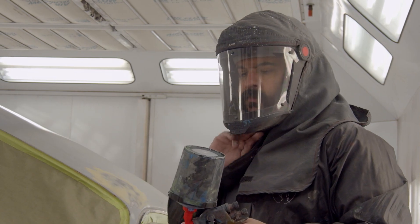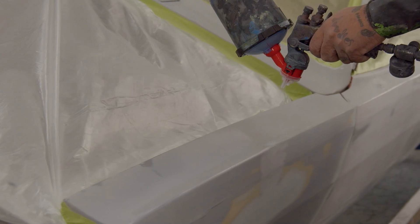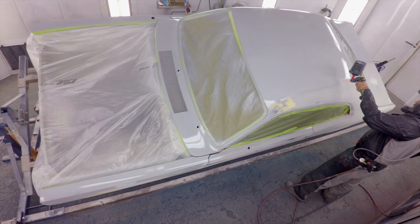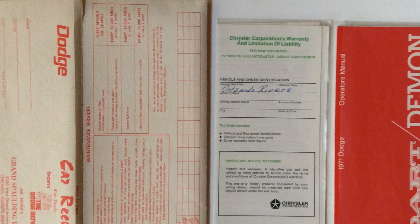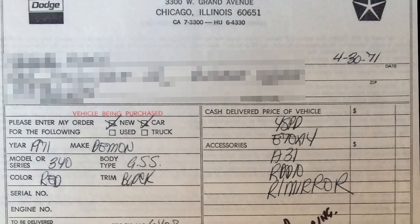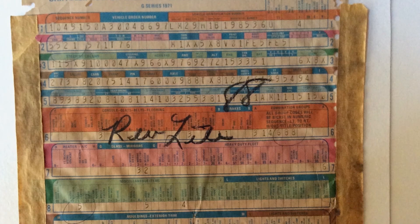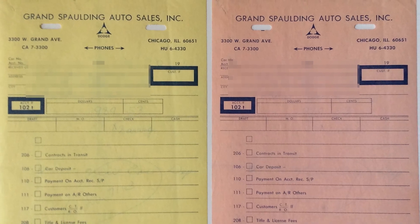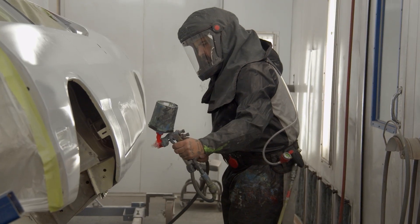Mr. Norm used a mechanical secondary linkage instead of vacuum, so it was much more responsive. They topped it off with a cool aftermarket Siegel air cleaner that says 'tri-power' on it — and that is not a Mopar term for three two-barrel carburetors; Ford and GM used it. Mopar never used it until they came out on the Dodge Demon. I honestly have not seen another muscle car come through here with the documentation this car has: the original window sticker from Dodge, the original window sticker from Mr. Norm's, the broadcast sheet, the key tag, key tag numbers — every piece of documentation right down to how much money they put down when they bought it. That makes this a thoroughbred 1971 Demon 340 Mr. Norm's six-pack four-speed car.